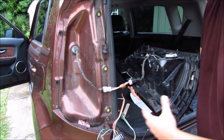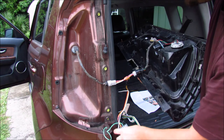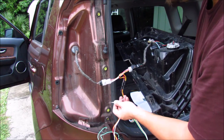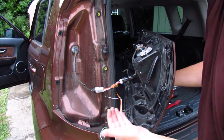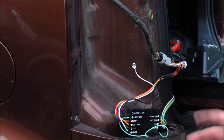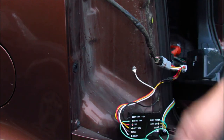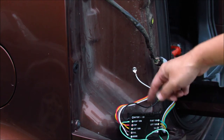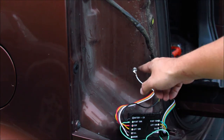I've plugged in the driver's side harness, and I want to make sure this box is not going to interfere with anything. We also need to make sure it gets a good ground to the car. The kit includes a self-tapper screw, so you're going to find a spot that isn't going to be pushed out of the way or rubbed by the harness. After test fitting a few times, my ground wire was best suited right here, following this peak straight over. You can sandpaper off the paint if you want a better connection — a lot of metal was coming out as I forced it in, so we should be fine.